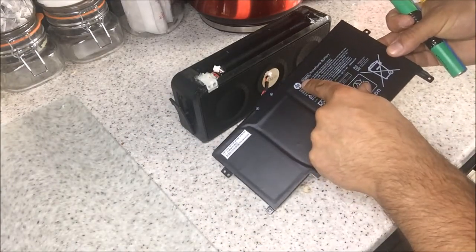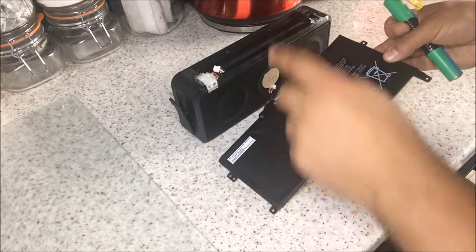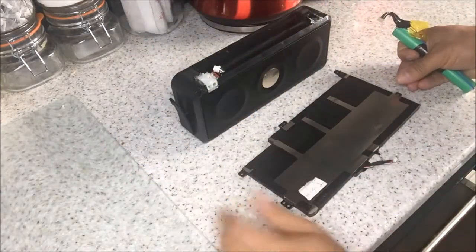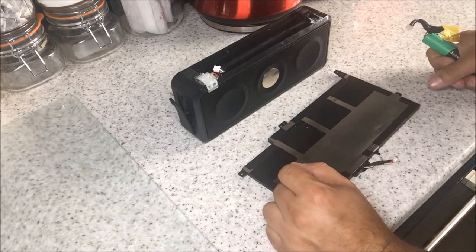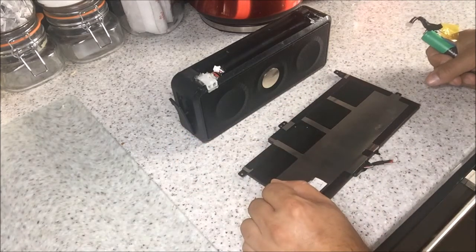This is an HP notebook battery. I've pulled a few of these lithium-ion cells out, checked them, tested them, made sure they work, and then we're going to pop them in on the bottom of this. With a bit of luck we'll have a TDK-A33, a Bluetooth sound speaker system that lasts a really long time.